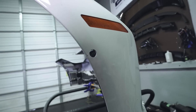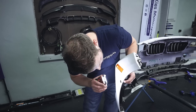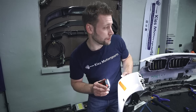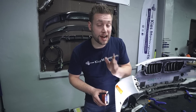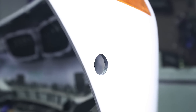Here you can see the hole drilled with the step bit. While both drilling options do a great job, I really think the PDC punch does a little bit better. The paint is more rounded in and the plastic is cut and pulled in slightly with the punch, whereas with the drill it's more of just a cut edge. Again, both options work fine — especially if you haven't painted yet. But if the bumper is already painted, I would highly suggest the punch.